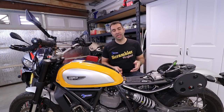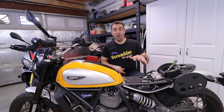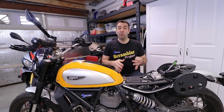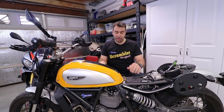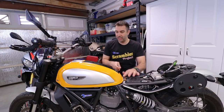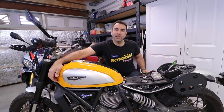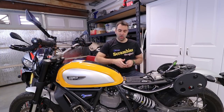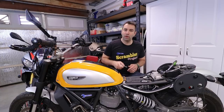I like things done in a certain way. Removing the seat is super easy, and if at this point you don't know how to remove the seat, maybe you shouldn't be doing this. Moving on, we're gonna lift the tank. To lift the tank we're gonna remove those eight millimeter bolts over here and also these T30 bolts over here. There is one per side, so I'm gonna start doing it — follow along.